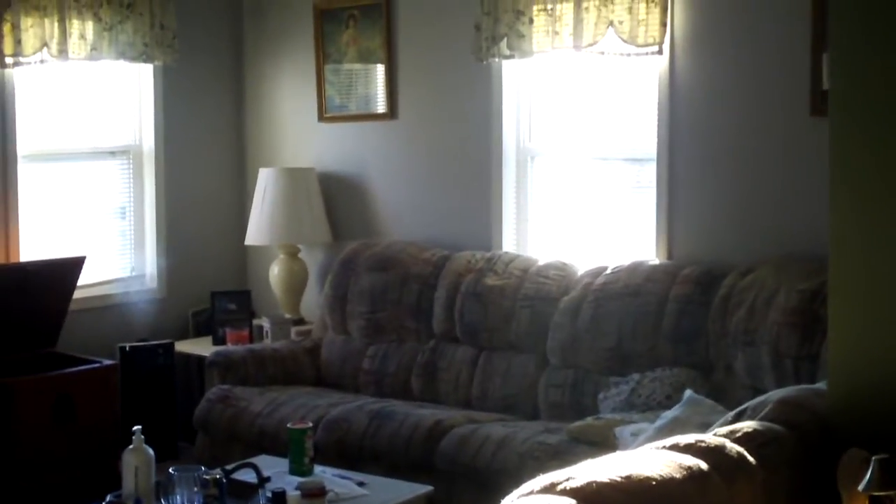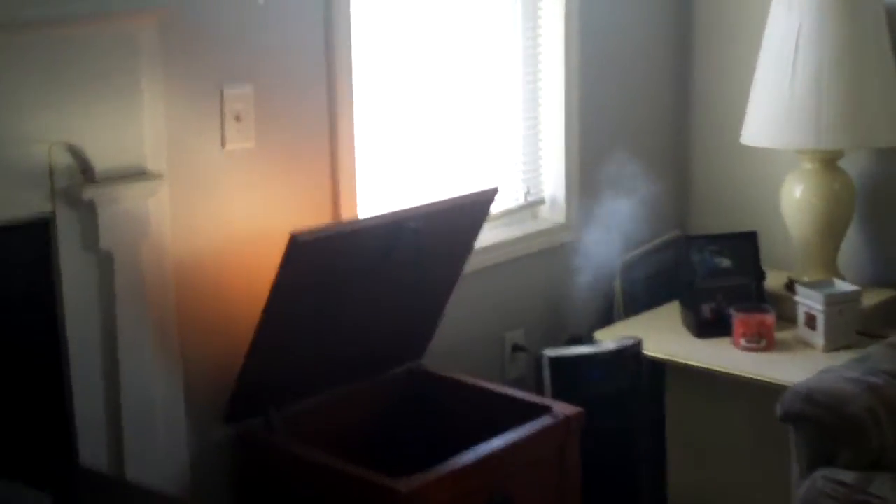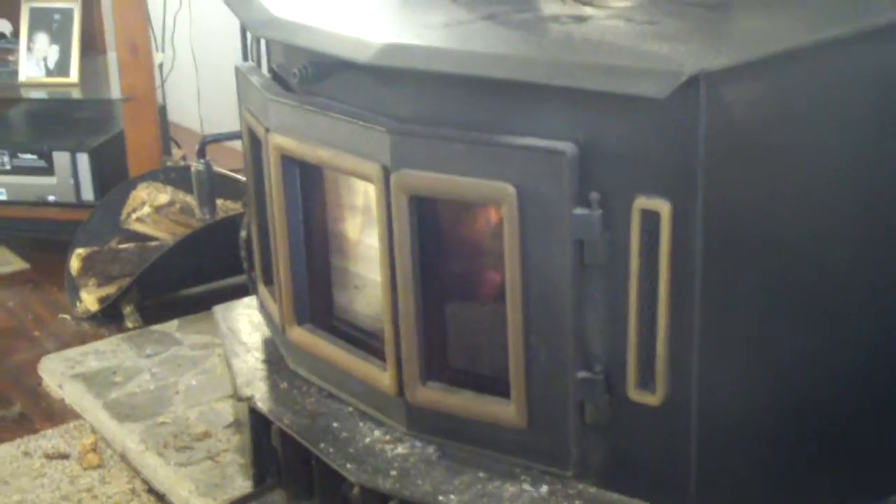So if in the environment you're fixing computers in you notice you're getting shocked a lot, you may want to get one of these — it's called a humidifier. The humidifier does exactly what it says: it humidifies the air in the room. You just fill it up with water and it puts out a cool mist — it really depends on what kind of humidifier you have — but basically it brings up the relative humidity in the room. During the wintertime, if it's 30 to 40 degrees outside, the humidity might be around 60%, but when you warm that cold air up, the humidity drops very fast.